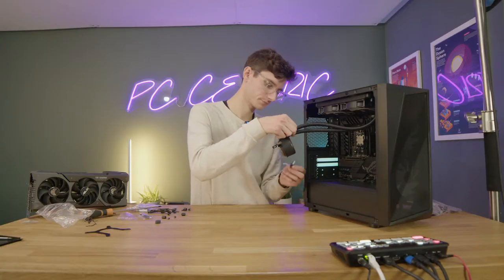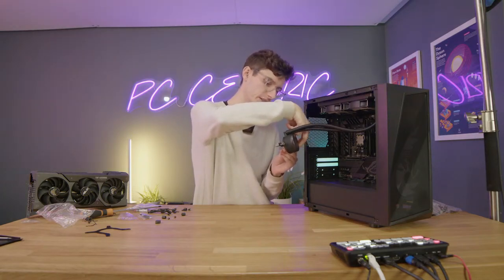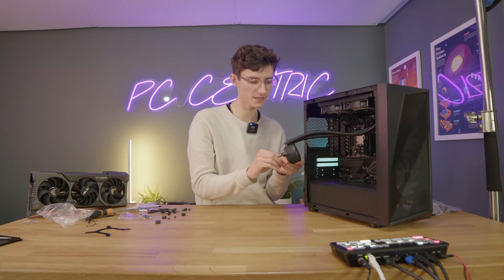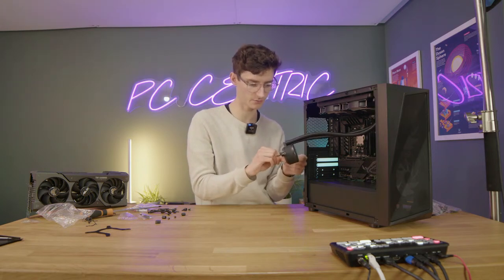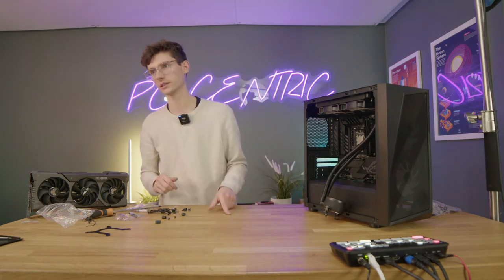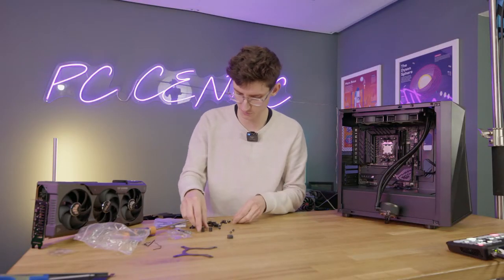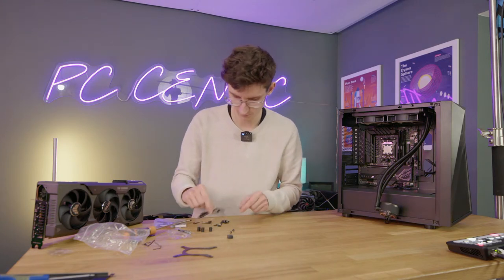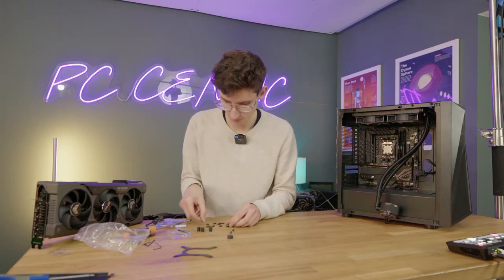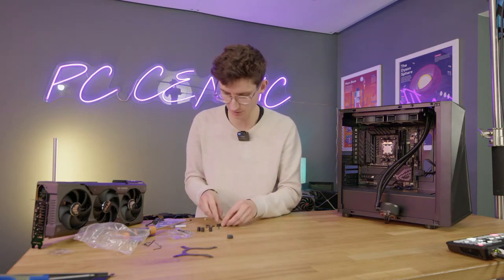Is it normal for a 5800X3D to hold 90 degrees in games? Yeah. 55 degrees idle? It's got a water cooler mounted up top. That sounds a little bit high on the idle, but I remember when I tested it, it runs pretty hot. It's a lot worse than the regular ones because of the 3D cache. The regular ones were like 70 degrees if you've got a decent cooler. So, yeah, that is high, but as long as everything's working properly, I'd say that's probably fine.